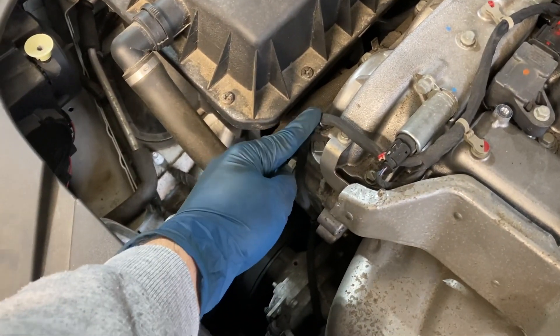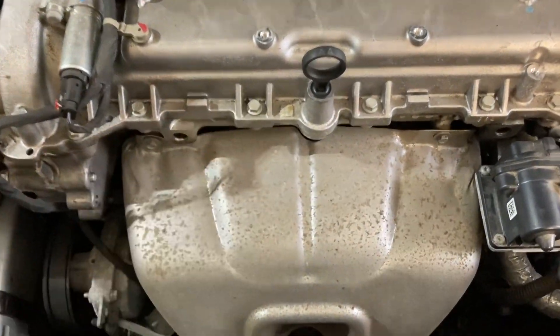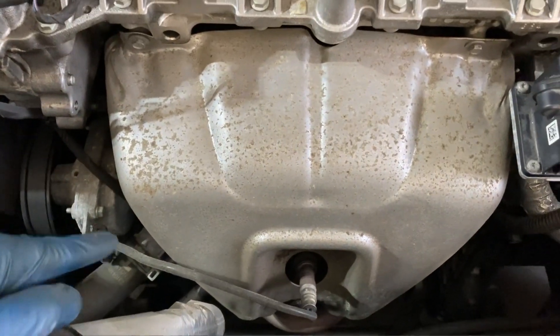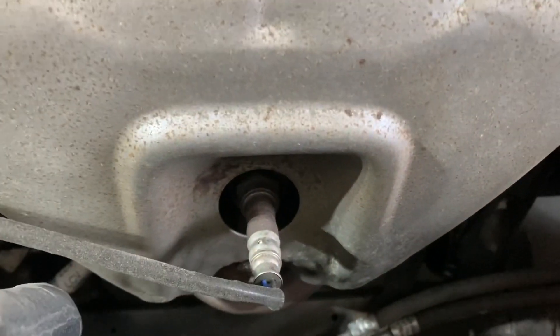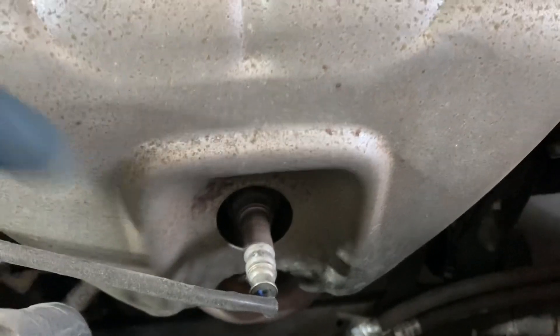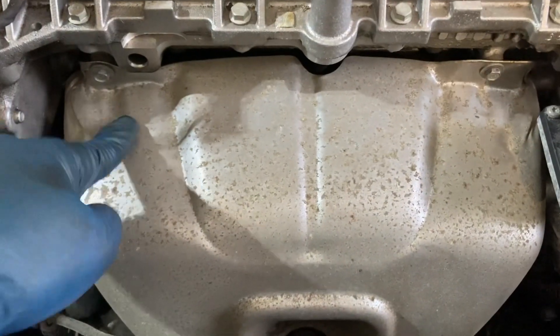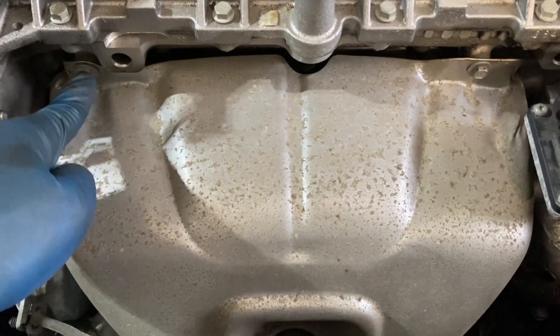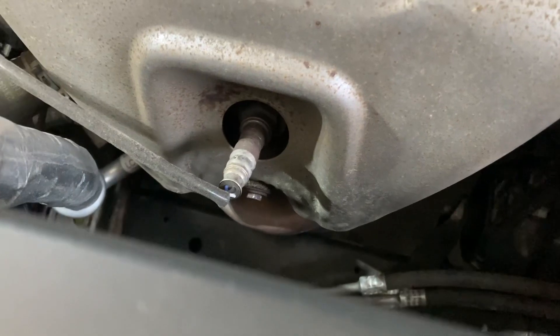You'll need to pry this wiring harness out of that hole and then remove this heat shield. After this little heat shield is off, you'll want to remove the oxygen sensor and the manifold heat shield. The oxygen sensor is just that plug right there, and then there's a big socket in the manifold. The heat shield is held on by three 10-millimeter bolts — there, there, and one right under the oxygen sensor.